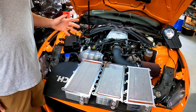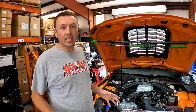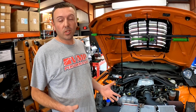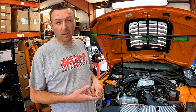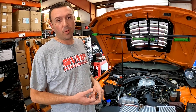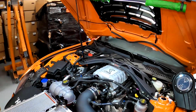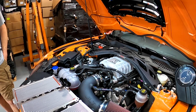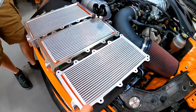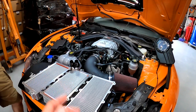Some people are saying that we need a dual pass intercooler or one of these big things in the lid. We've already proven with our Odin supercharger system — you don't necessarily need a huge intercooler core. You need the right intercooler core and you need to carefully watch pressure drop across it. It's all about moving that CFM, and if you can move airflow through the core more efficiently on a positive displacement blower, that pays massive dividends.